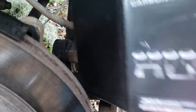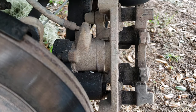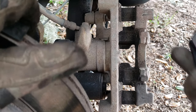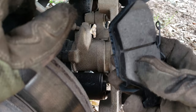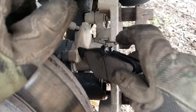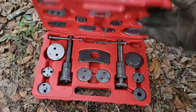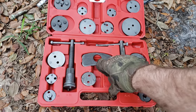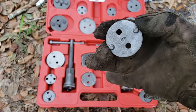The brakes I'm using are the Power Stop Evolution. You can use whatever pads you want — these seemed like a good price and they're low dust. I don't use performance brakes because it's typically not an issue for me. Before we put this pad on, this is the thing that's different — this is an electronic parking brake. So we've got to actually retract it, and they made a wonderful tool for this. I got this off Amazon for less than 20 bucks — I'll link it in the description. It's a set of different pins that slide in, and it seems like a pretty universal kit.